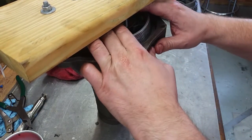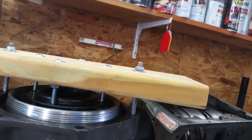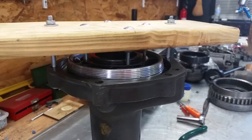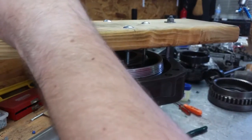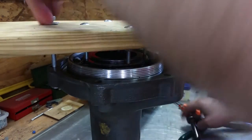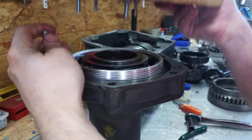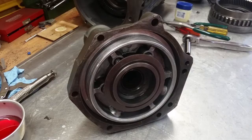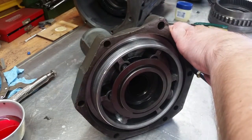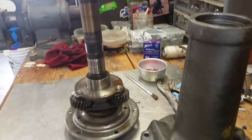Snap ring up in here. Let's see if you can see that. So here's my snap ring, and we just need to use the pliers to get that in. As you can see, I managed to get the snap ring in. A little bit challenging. It would be easier, of course, if you had the real specialty tool, but nonetheless, did the job. All right, just to test your work, a cool thing about this is that you can put air pressure in here and watch. There you go. All right, next I can slide the internal gear down onto the output shaft.